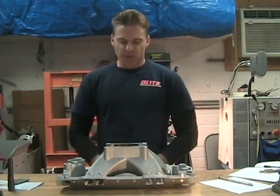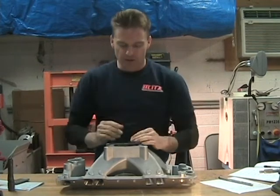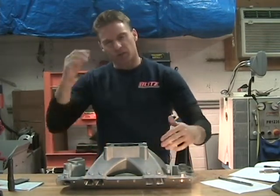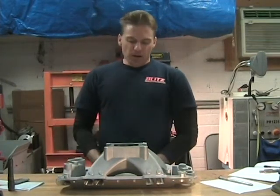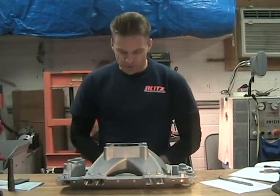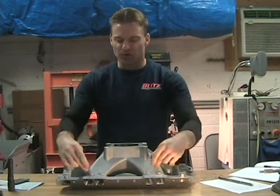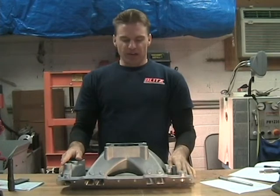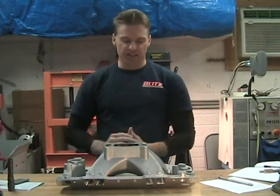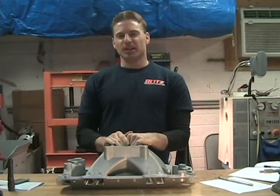To be honest, the down-and-dirty conclusion is you could pretty much go back in there like I showed in an earlier step — this 60-grit will knock down just about as much of the casting flash and leave it a little rough, and call it good. That bottom area, basically what I've concluded, is that when air moves to the carburetor it hits the bottom and basically bounces back at an angle, so it's kind of a dead space. The top of the port and the long sides are where the air really likes to move through the intake. That extra fine detail and polish in the bowl is more show than performance gain — it's not the restriction point. The restriction is further down, so save yourself the grief.